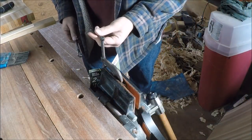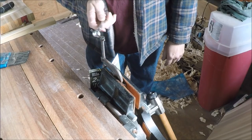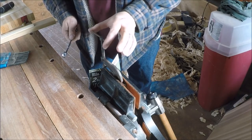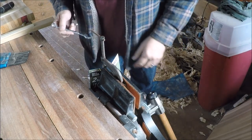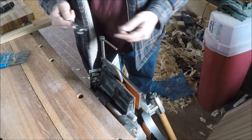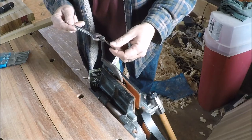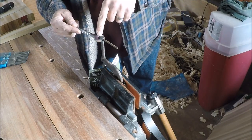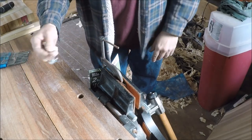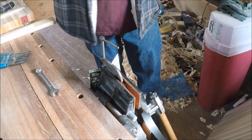This is a tip well worth noting: if you're ever trying to get one of these things unstuck, guys will stick a wrench on here and push on it, and inevitably this little tiny pin is gonna get bent - that's probably not the best way. What you should do here is use a socket - this just happens to be a 9/16s which will fit over that shaft, and then the ball kind of acts like the face of a nut. Make sure to remember that.